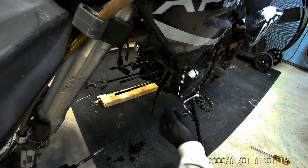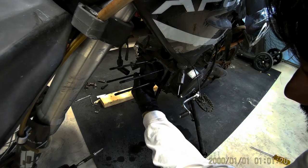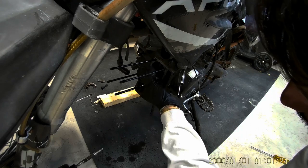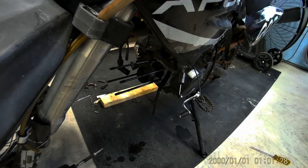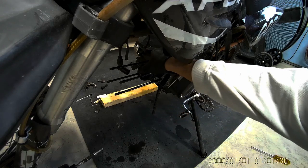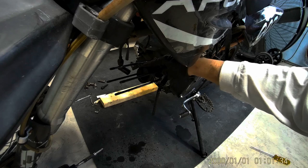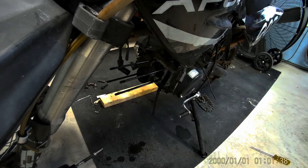But anyway, hopefully you saw it on the time lapse, and it looks like the bottom end of the engine is still good. The piston, however, is completely frozen on the shaft. It won't tilt or move at all on the wrist pin, and the rings are completely gone. The inside of the cylinder looks to be okay. I'll show you that in a minute.